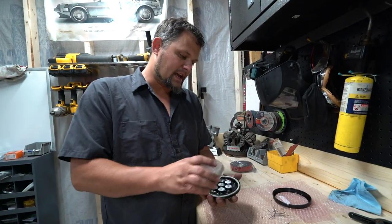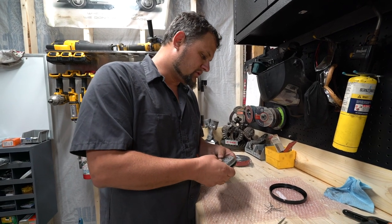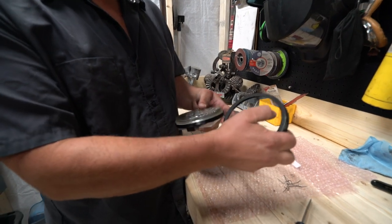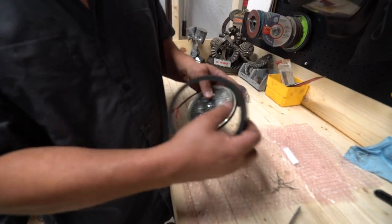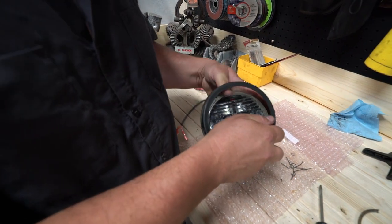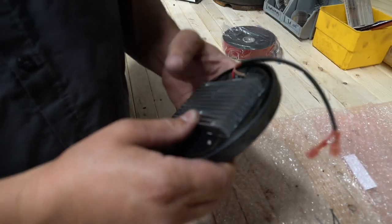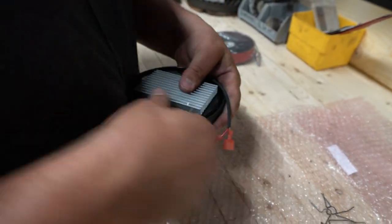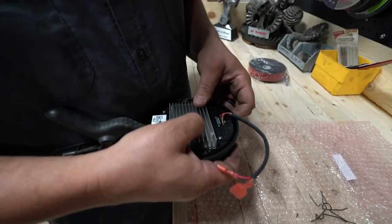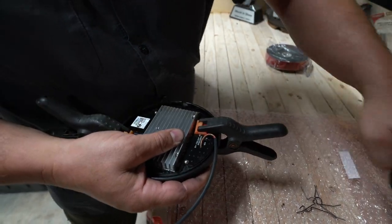All right, so once we set our gasket in, set the lens on, key to the little top, you're going to introduce it to the bezel housing, which has a very small indentation right there where my finger is, which is actually the bottom. You can feel it on the glass there. So your best bet, at least what we found is successful here, is to lay it on there, turn it over, and then put a couple of clamps on it gently. Nothing super strong, no vice grips, to hold everything in place while you get your wire clips.